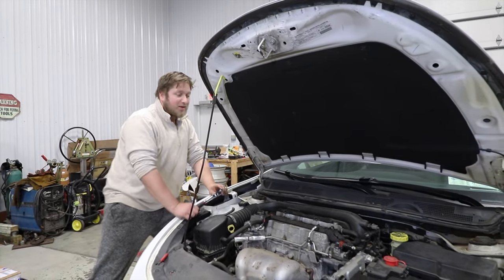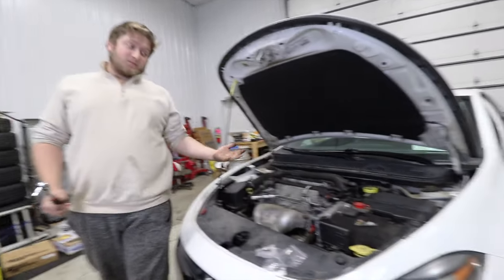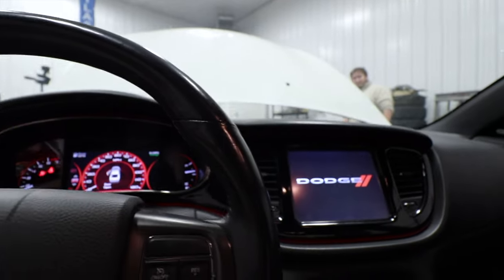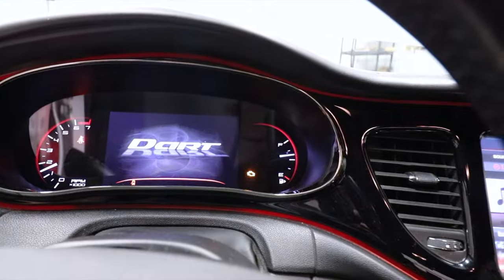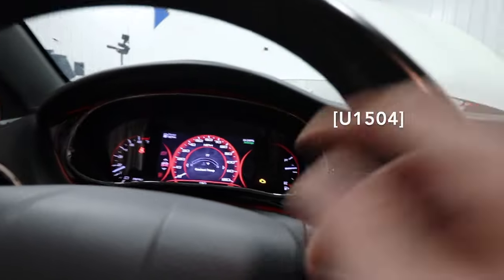Now we're going to start the car and make sure that there are no defective issues with the coil packs and everything works properly. Battery's connected. Let's go for it. Okay, cool, sweet. I'm going to have to do the clutch too. And no misfires? We have a check engine light. It'll be flashing if it's misfiring. I don't know what the check engine light's for, but it might be because the battery's not fully secured down. All right, we'll read that.